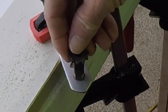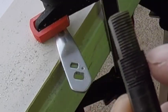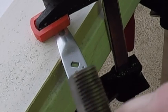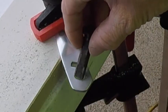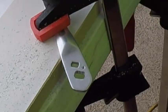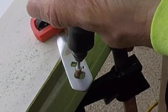Voila. Okay, so on these gear sleeves, there's a notch right there. So the hole on that handle shouldn't be bigger than this notch. When you stick this gear sleeve in, it should stop on that notch, just like that. You don't want it going past. And we're just going to clean it up. Even though this is pretty smooth, we're just going to clean it up a little.